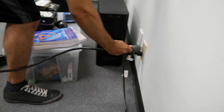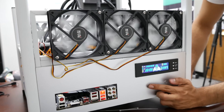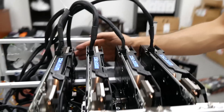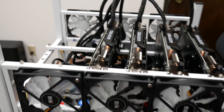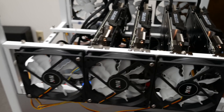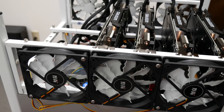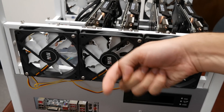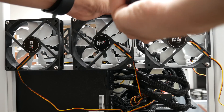Ben is connecting the final power cables, then we'll do some final wiring and power up to see how this thing turns on. Okay, we plug in the cable. Holy sh*t, it's on! Oh, I feel a lot of air. Is it coming out this way? It's pretty strong — wait, we put the fans in the wrong way; they're shooting air out the wrong direction. Okay, so we have to change it. We want to create airflow so the air flows from here all the way down through the video cards and makes them cool. I'm basically going to flip those fans.